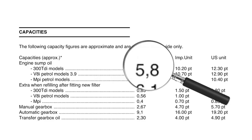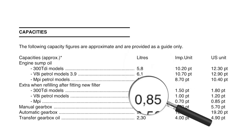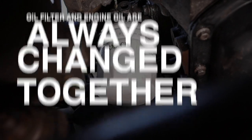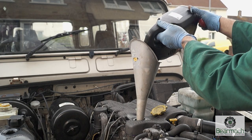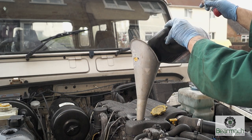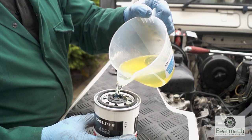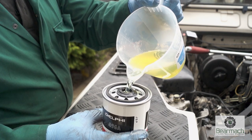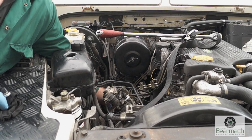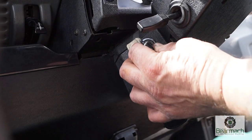The capacity for the 300TDI is 5.8 litres, and the filter is going to take nearly almost a litre on top of that. Filters always get changed when you change the oil. It's only an estimate of the amount Land Rover recommend, so you have to check it manually, but you can put 5 litres in straight away. Then, before going further, change the diesel filter — this saves time having to run around the vehicle turning it on and off. There's a link below on how to change your diesel filter and air filter, and how to bleed it properly. Then run it to prime the oil filter — you'll notice your oil pressure warning light will go out rather quickly.